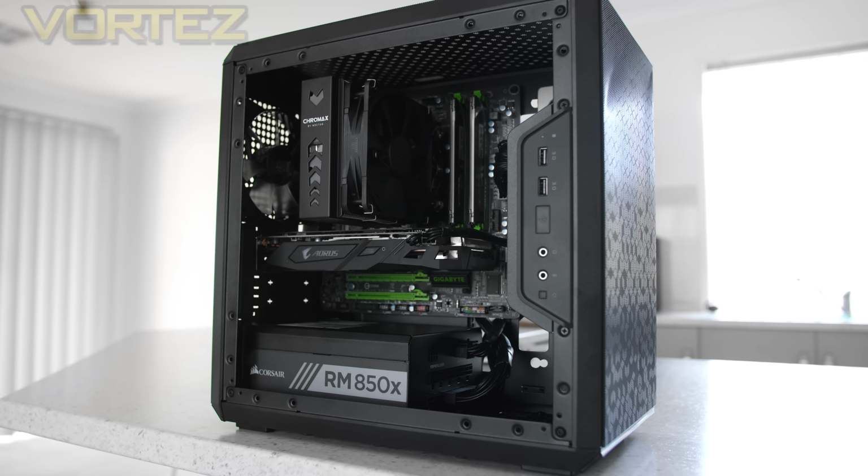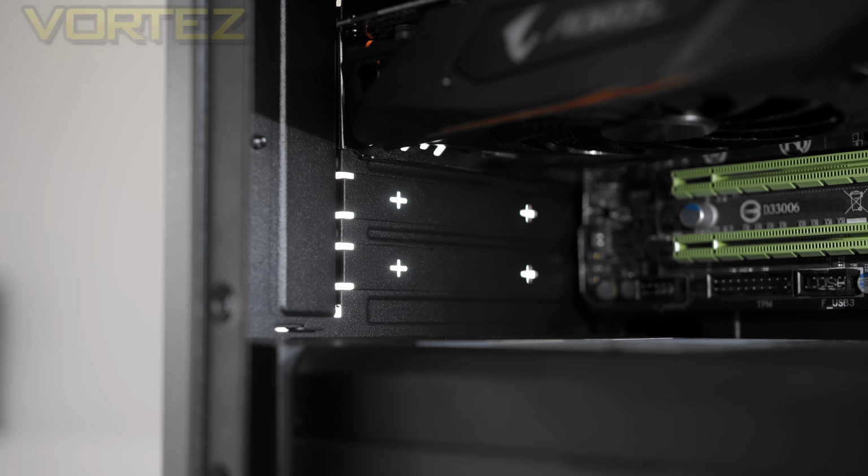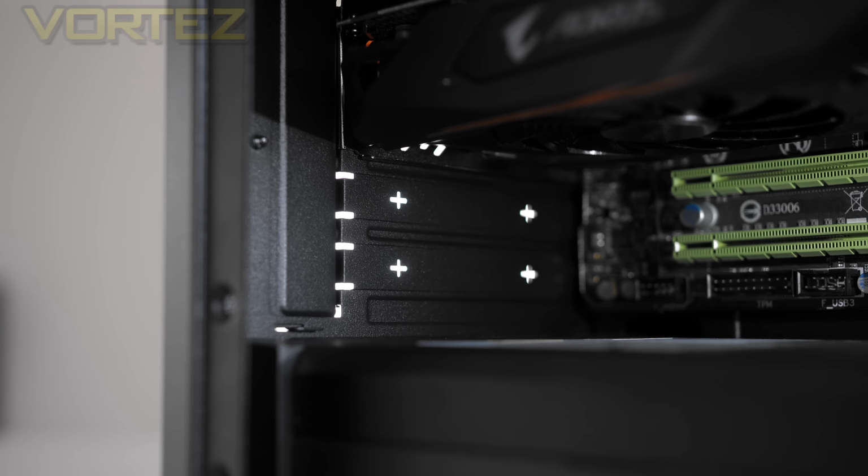That aside, one other annoyance are those push-out PCI slots. Yes, it's cheaper that way, but it also introduces hiccups in the build process that aren't really warranted. I would advise you to push them all out when first installing the system, and then get some blanking plates or use the PCI Express slot USB port adapters that often come with your motherboard. Dealing with them when a motherboard is installed can be a real headache, and it's too easy to scratch the board if you're not being very careful.